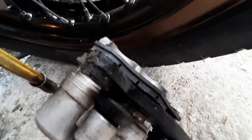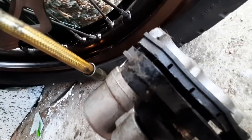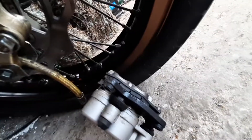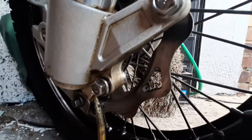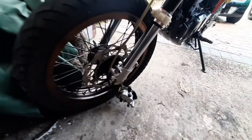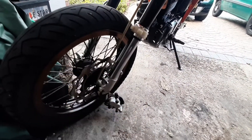So this is the inspection. I'm currently looking at it — it's got so much brake pad left. You can see the wear indicators, they stop like a millimeter before the actual metal and there's just so much left. I'm not going to bother replacing these. All that grime and nastiness that you see, that's all coming off. We'll get this looking nice and clean, just go mad with the brake cleaner, get all that done and then that'll be the front brake done.